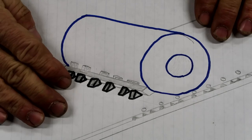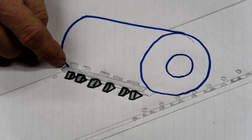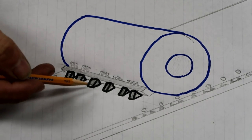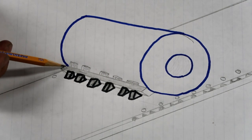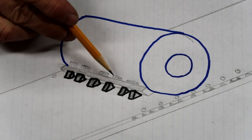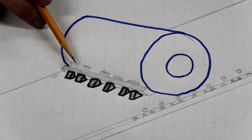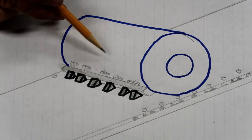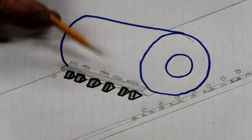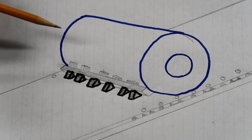This illustration shows the trailer with the coil sitting on it. You've got your rack — your saddle — built with coil racks, which are these pieces here. Your timbers can either be beveled or four-by-fours depending on the type of rack you have. These little pieces sticking up are your rubber mats, which protect the coil from damage from the racks, as well as keeping it off the deck of the trailer in case water gets under your tarps.